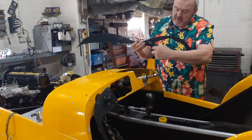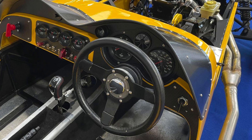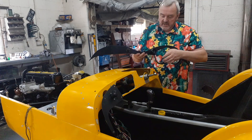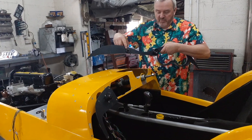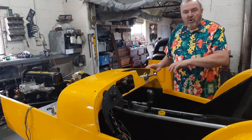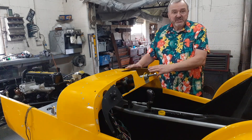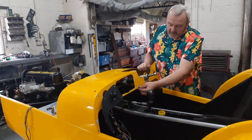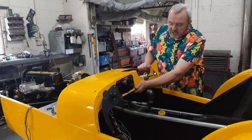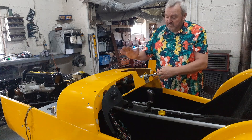If you saw the last video, you'll see me making another one of these as the little infill piece, because this is set back from the main dash face — we needed to bridge that little gap, and that's what this piece was for. Underneath here it's held on with just a couple of little dome-headed bolts. I've got the shift light coming through it — this is the adjuster for the shift light cut-in point and the light itself. I've had to modify the housing for the shift light to clear the aero screen because it was pointing too far outwards. You can see how much of the dash I've had to cut away to make this work. It's not structural, but it still needed to be reasonably stiff, so I've got a bit of inch-by-inch aluminium right angle and riveted it underneath the lower ridge of the dash all the way across and right up into the corners. This has put the strength back in the middle so it doesn't end up floppy, and when all the panels and the aero screen are screwed on, everything gets nice and stiff and stays still.